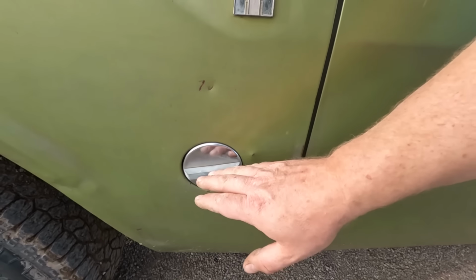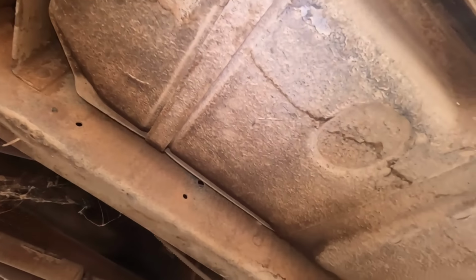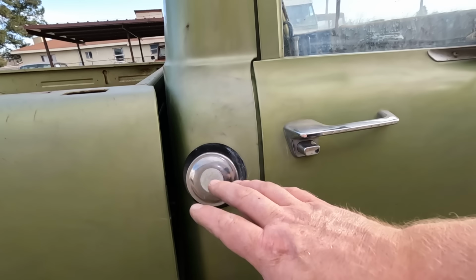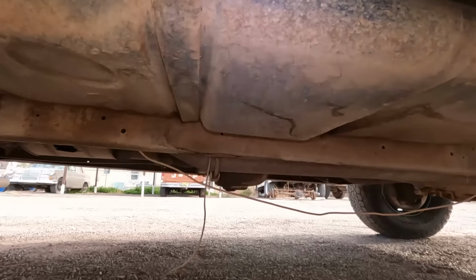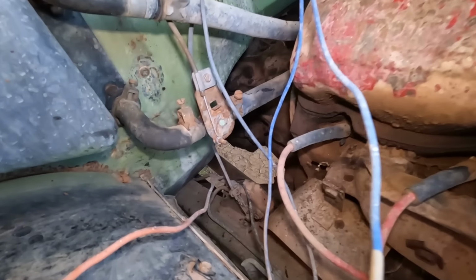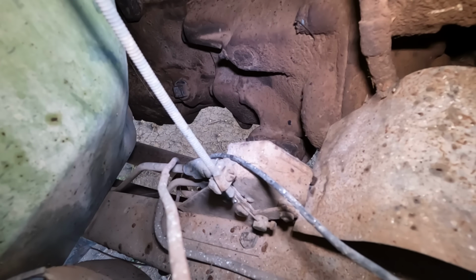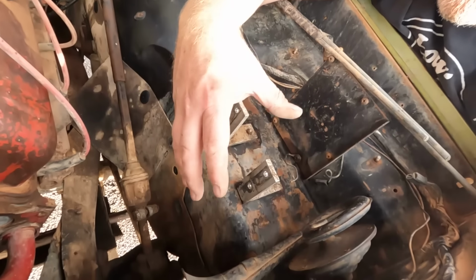Some people asked about where this reserve tank was. Let me show you. It goes in here. The filler neck goes down along inside the fender behind the front tire. And there's the tank down there. Now on the other side we have the filler neck up here, like on trucks that have the tank behind the seat, but that goes down to here, and the tank is underneath. So twin side mounted gas tanks with fillers in completely different spots. And under the hood here is the valve that selects between tanks to switch between the main and auxiliary from the dashboard. Now the oil line here and brackets here, that mystery is also solved.